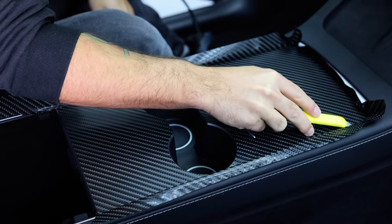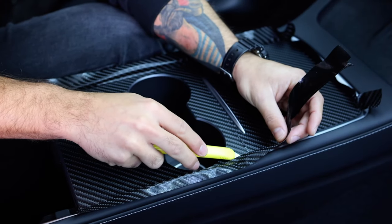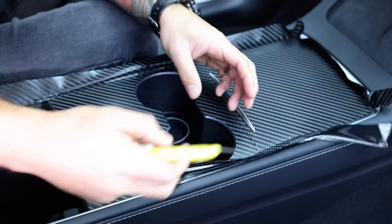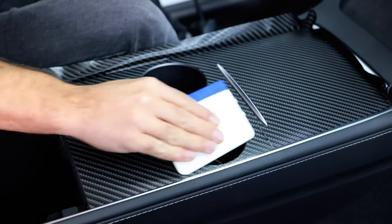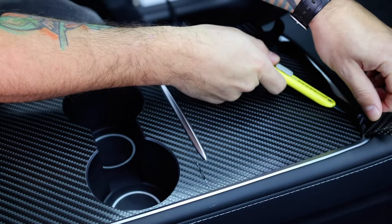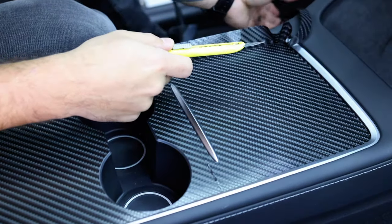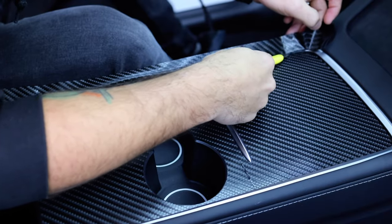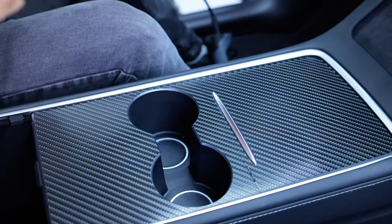Removing the excess film on the outside is next. Because the film was tucked firmly into the gap and uniform on all sides earlier, it can be safely cut away with a very sharp blade, with the tip of the blade running in the groove. If the material is set up properly, the tip of the blade won't cut the vehicle or cut the material short. Keep in mind that working in a car can be slightly cramped, so a good tip is to work in stages — work one side, cut the excess film away, tuck it into the groove, then work the next side and so on. This leads to good quality and safety.